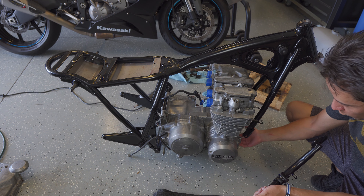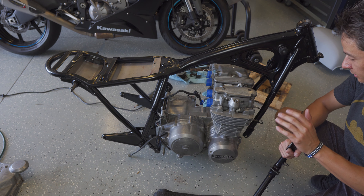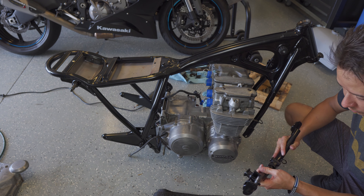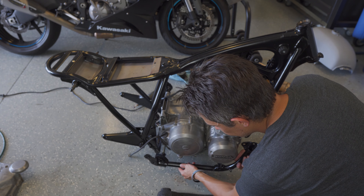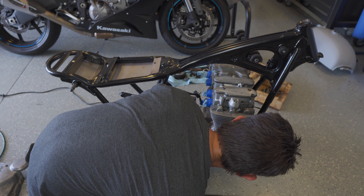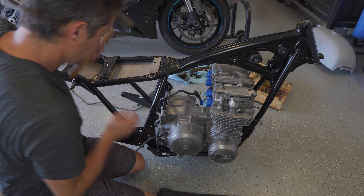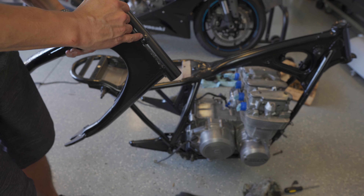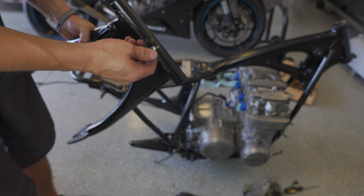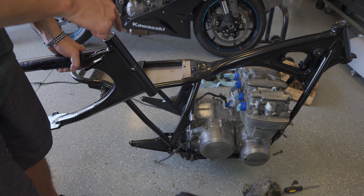I now have the bike on a couple of pieces of 2x4 on the front and slightly resting on the oil pan in the back. One of the good things about living in a housing community where they're still building — there's an endless supply of 2x4s just a quick jog away. I have the bolts resting on the left side, and then the breakaway piece I'm going to slip on this side. Before I had the swingarm powder coated, I put a bolt in the hole where the grease fitting goes to make sure I didn't get any powder coating material in there. I'm going to back that bolt out, put the grease fitting back in, pack it with grease, get the end caps on, and get the swingarm back onto the bike. I also have new shocks to put on at the same time.